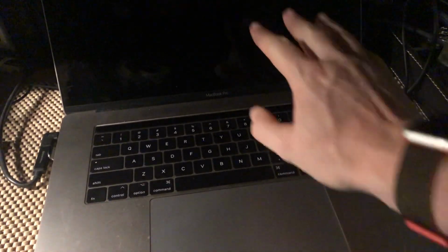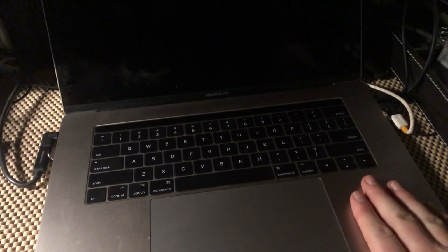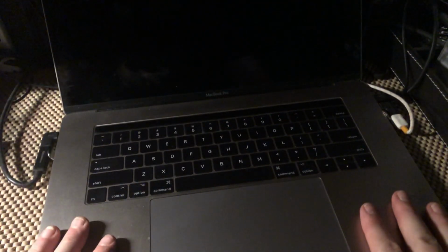And you'll have a faster external display because it's not driving two displays. Both of my displays are, or one's Retina, the other is a high definition display. And I don't want to be driving a Retina display that I'm not even using. Why do that? It's just taking up more video RAM and obviously slowing down the video processor. And I use the dedicated processor all the time on this. It's partly why the fan's always running. So this helps you cool the machine down.